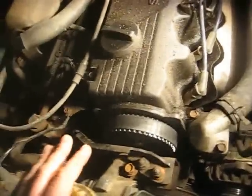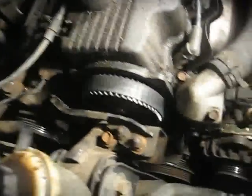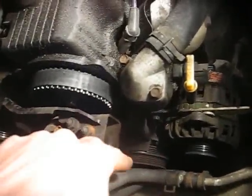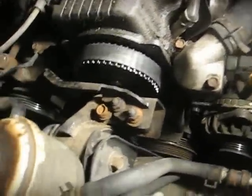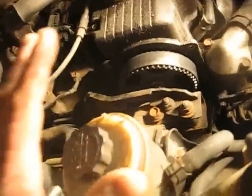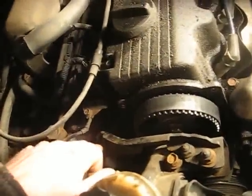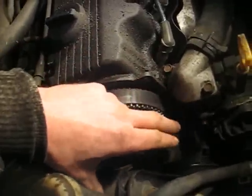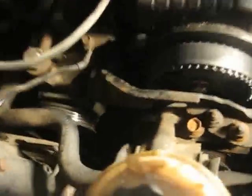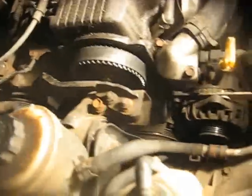I don't know where the Banana is today, so I'm going to go ahead and keep doing this on my own. I've already taken off the alternator belt and the power steering belt. This one has air conditioning, but the belt hasn't been on there, so I didn't have to remove that — if you had AC still connected you'd have to take that off. My next step is to get this out of the way, take this bracket off, and that will allow me to get the motor mount out of the way so I can jack up the engine to get to that water pump pulley, which has four bolts but the frame is in the way.